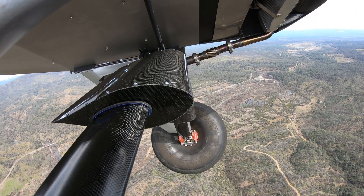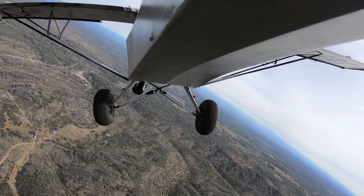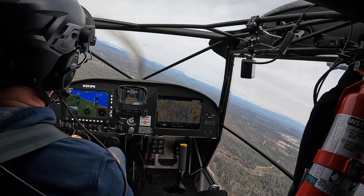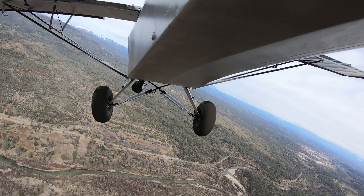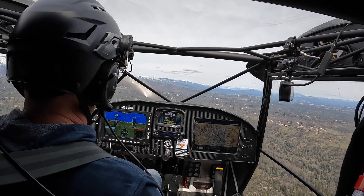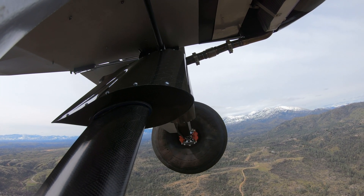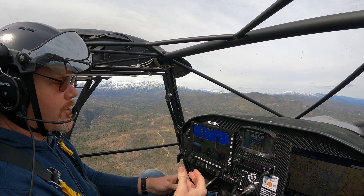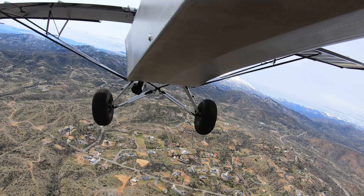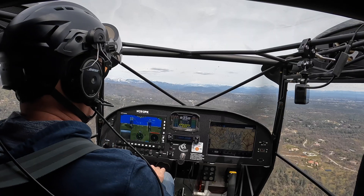That's as good if not better than the Grove landing gear with the shock wheel from Beringer on it. But now I've got the Shock Monster landing gear with the fairings and the gear legs covered, so I've almost eliminated the drag excess over the Grove and shock wheel design. That's pretty cool. Cruising around 104 right now — it's very bumpy. Speed varies with temperature because temperature changes your horsepower and also changes air density for indicated speed, so we're looking at true airspeed in comparison as well.